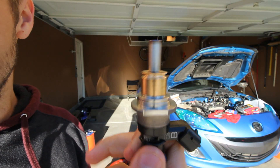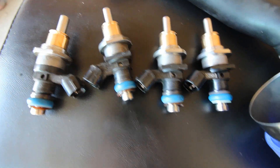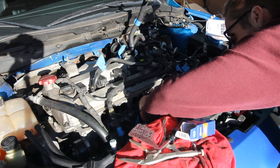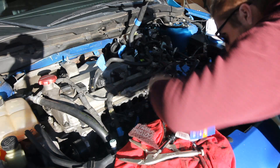This is what the finished seal looks like — a much better seal than that rubber piece. Here are all four injectors with the seals on them. One is brand new and the other three are old ones. They don't look much different, which is good. Injector one goes in a lot easier than it came off. Last injector — the brand new one — fits great.